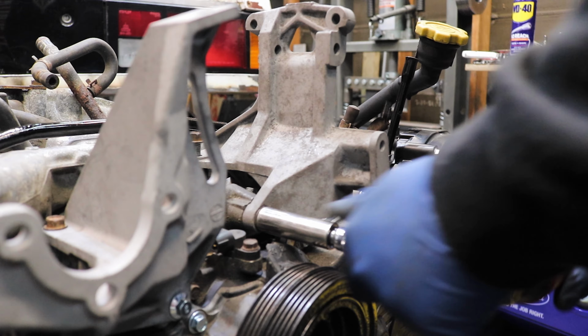That's really important. Then pull it all back apart, get this thing cleaned up because it is covered in just crap from being in there, and more importantly, get it freshened up mechanically, like new timing belt, water pump, that kind of thing, because it does need a lot of maintenance just to get caught up on, like any used engine that you buy. So then after all that's done, we can finalize the harness and move on to fuel routing and power distribution. Easy, right? Let's go.